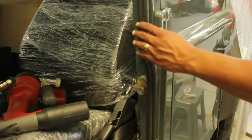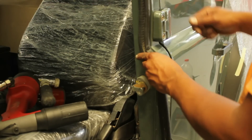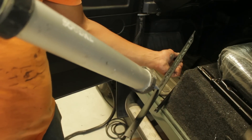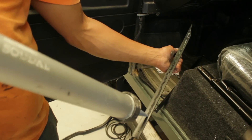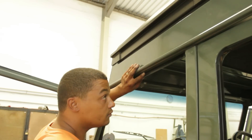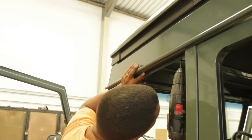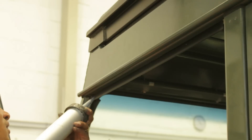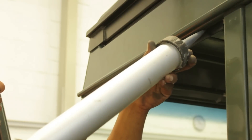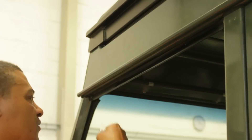While bolting down the roof, you can also set about replacing the door seals and checking all doors are fitting correctly and aligning up. You will notice there is no angle or aluminium to mount the door seals at the top of the front two doors. These angles are supplied separately and you will need to drill and rivet them in position, applying glue behind the plates, aligning the rubber door seal mount with the existing Land Rover door seal mount area.